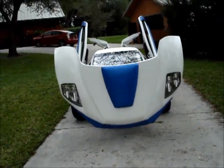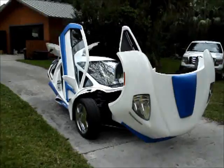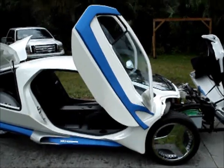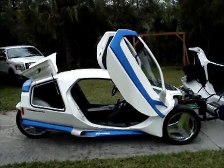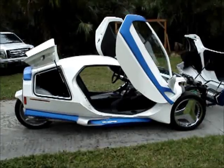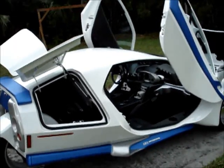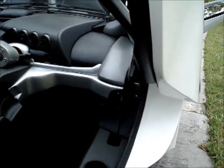This is what the car looks like from the front with all of the doors and openings opened up. These scissor doors — there's no aftermarket kit for those for this car, so all of that had to be custom designed. I came up with a mechanism that allows the car doors to slide out about 3 inches and then they can be lifted up manually, rotating up to about 60 degrees with just your arm giving it a little push to assist the gas charged struts that hold the door up.